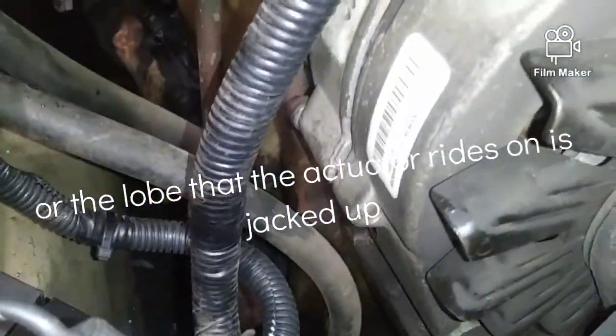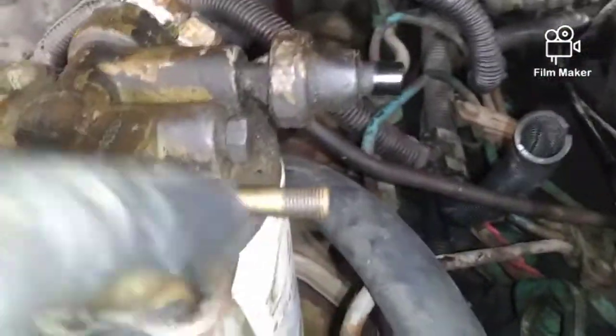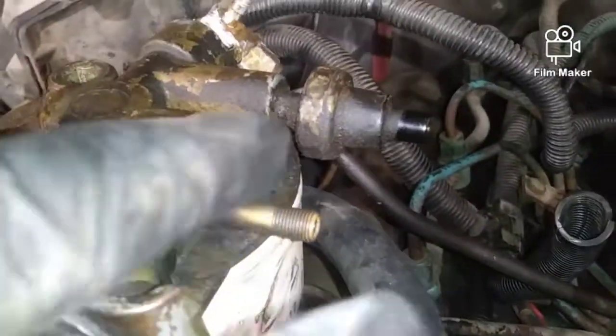We also have that one that's down there. He's the guy that's in charge of making a squirt out there. So if you're not having a squirt out there, then you're having an issue with either a blockage in your line, no fuel, or the diaphragm down there on it is bad. You just have to go through the steps to figure that out. But that's what that's for: hooking up the gauge and to get air out. You can also use this guy to get air out.